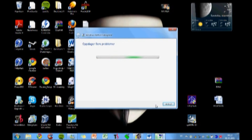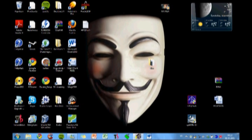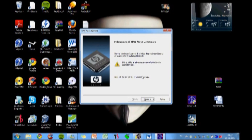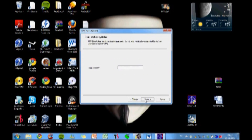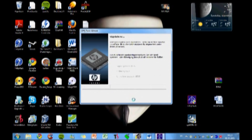After the first troubleshooting, I am going to try to flash the BIOS. You can find the file from the manufacturer's website and download it. I have downloaded it to the desktop and you should probably have all the files together. Now I am going to run the setup — just follow the steps and everything should go fine. But remember that you need a full battery or have the PC charging while you are flashing, or it could damage your hardware. You will be prompted to type in your BIOS password, and if you don't have one then just skip it. Just follow the steps, and for the next window you can choose to take a backup of your files in case something happens, or just skip it.